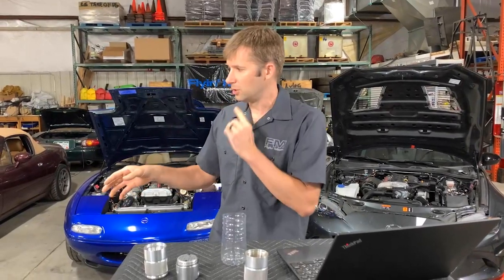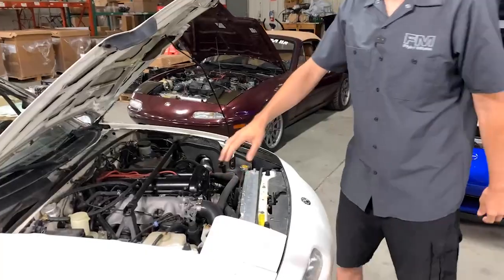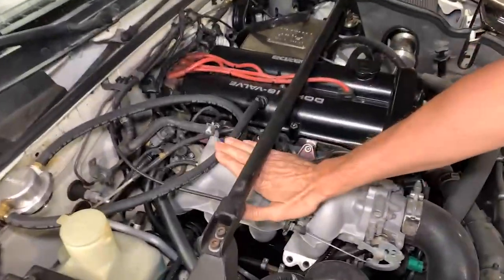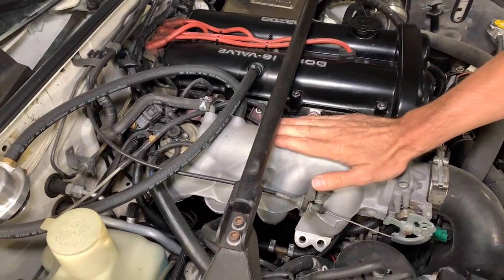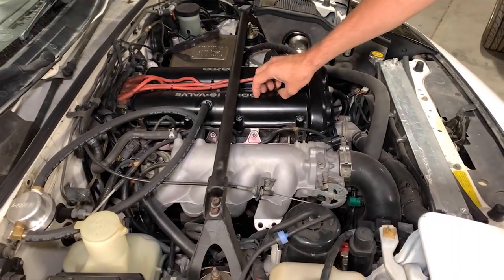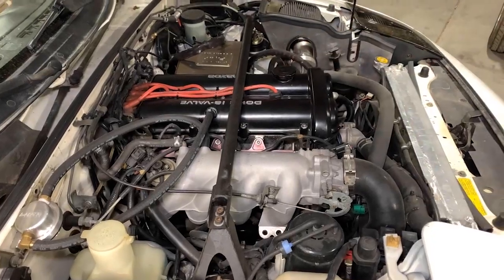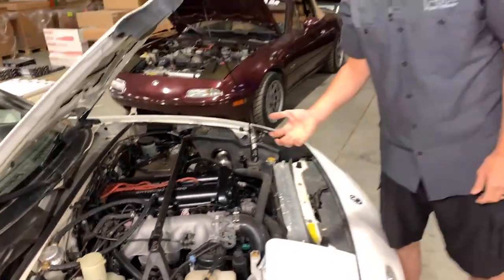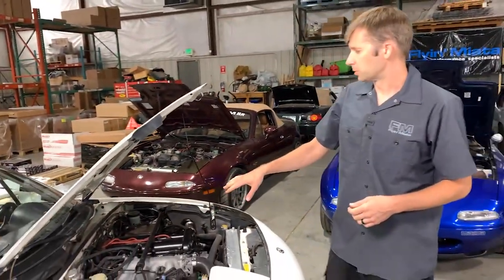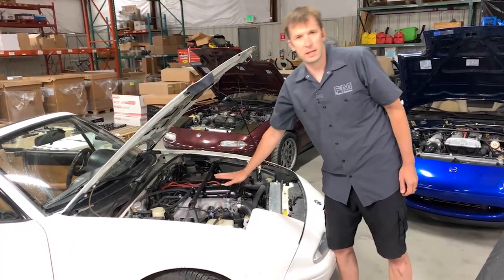When you're driving your car, inside of the engine — inside of the crankcase — there's an oil mist, a vapor that is air and oil. Your PCV system has vacuum in it most of the time, and some pressure, so that vapor — that gross stuff — gets sucked into your intake manifold. Obviously it gets sucked into the engine where it's burned, which is bad. What we're trying to do is make it so that there's only air going in there.